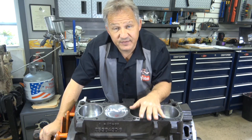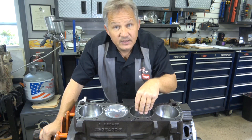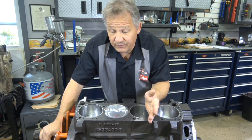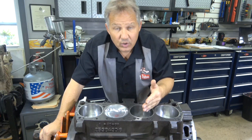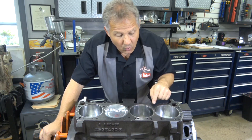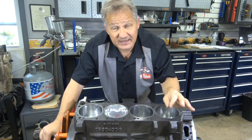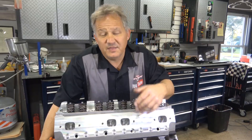This is why it's important to diagnose and understand what the failure is before you try any repairs. Is it leaking cylinder-to-cylinder? You can't fix that — there's no coolant involved. If it's leaking from a cylinder into the coolant cavity, there's coolant involved so you could pour that stuff in and it would seal it. Or if the coolant is leaking to the outside of the engine, there's a chance that kind of repair might work.